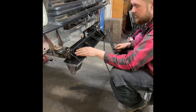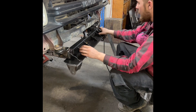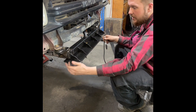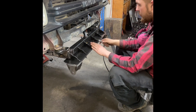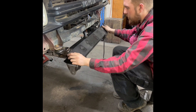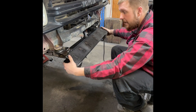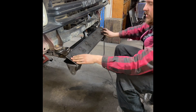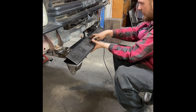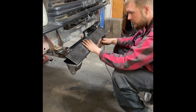Your hanger will then be set. You will then tack your little side gussets that go in here - you have six of them. I like to start on the inside and work my way out. These are your outside caps - that way you protect all of the elements from getting inside your hanger. You will then put all your caps up. I do these two, one, one, one and one. Each time I like to sit up my plate, clamp it here, put it here, and then clamp it in the middle - it'll hold it all down flat.